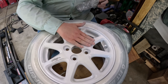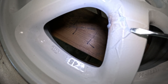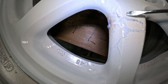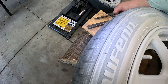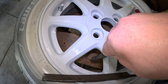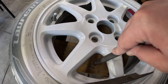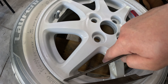Right now you're just seeing dull and shiny — the dull is what was taken down and the shiny is what was not touched. This is the welded wheel. As you can see, I'm just kind of scraping off what's bubbled up with a little flathead screwdriver. Then I'm going to go back and sand it, using a couple of cut files, and just taking down this little bubble.